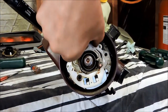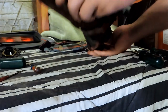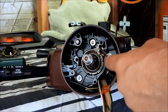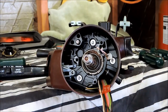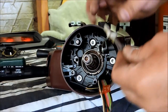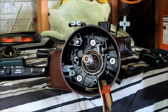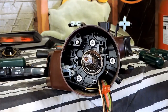This piece will now come free and come out — just remember you've got connectors down there so it'll be a little bit of a challenge to free it up. There's the turn signal assembly — actually a really nice looking column here. Next thing that has to come out is this piece right here, which is your key-in indicator. If the key is still in the ignition, that baby will make some noise. Let's go ahead and take that out with a pair of tweezers — not the ideal tool, but it's what I've got. This white piece comes out, and there's a little black piece that generally pops out with it. You don't actually have to remove that black piece, so I'll leave it in. Most times those will fly right out, but if that one wants to stay in there, no big deal.